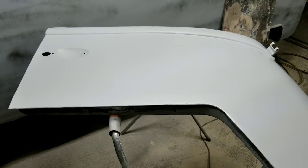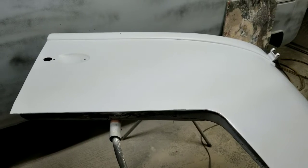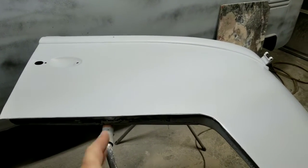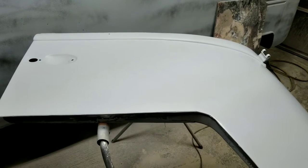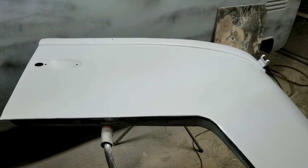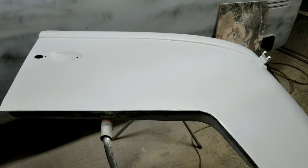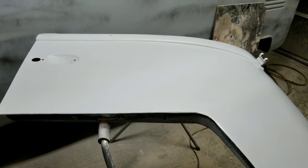and it had filler on it that was thicker than I wanted it to be, because I don't like 1/2 inch or 1/4 inch of filler on my work. I try to stay under that. Usually I'm at 1/8 or something. So I said, dude, I really need those door skins. So next year I saw he had door skins.